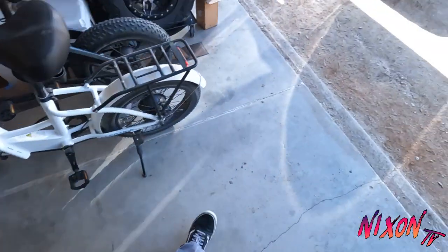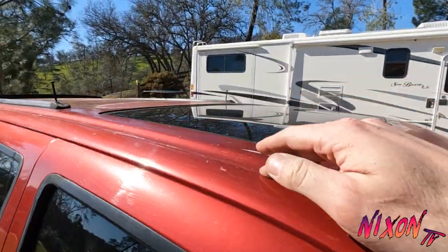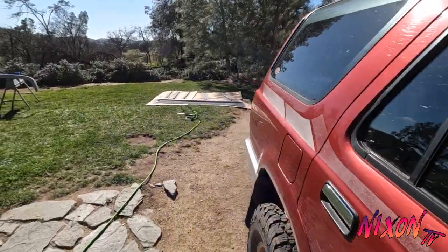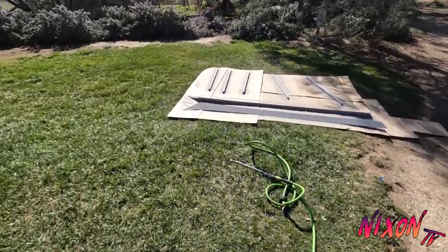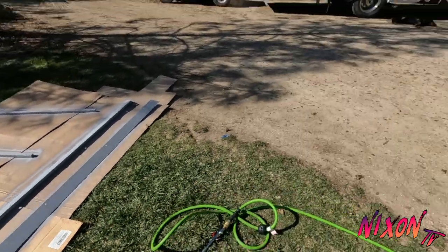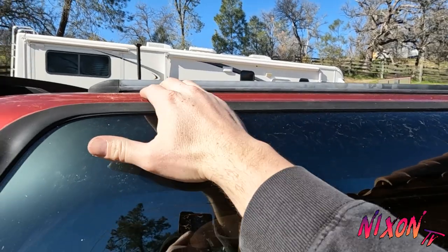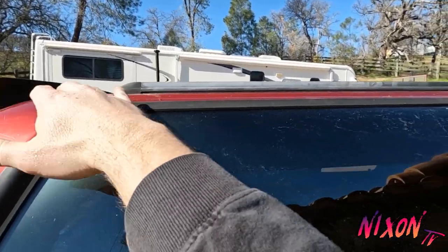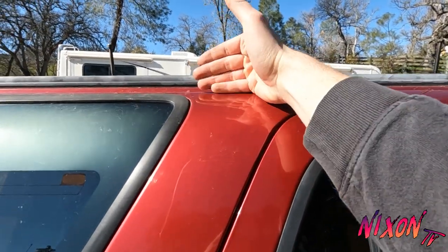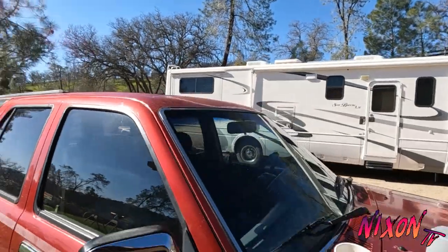So that neoprene tape will stick in this drip tray right here all the way down. The U-channel will go on the bottom part of the siding, so right here all the way down. And that will give me a good cushion in between the metal and the paint, which I'm not too worried about the paint getting scratched because it's already pretty scratched, but I don't want it to just continue to rub on there and flake the paint off and then rust. So that should handle that.